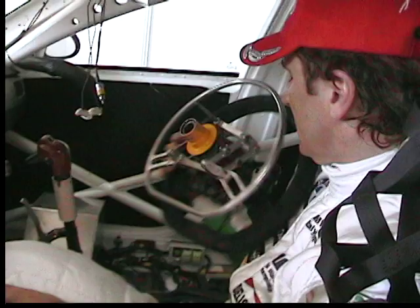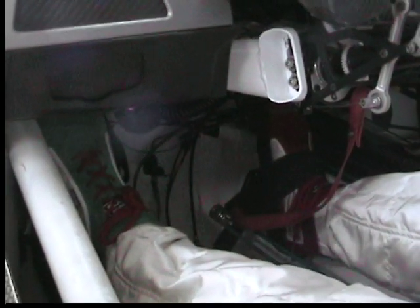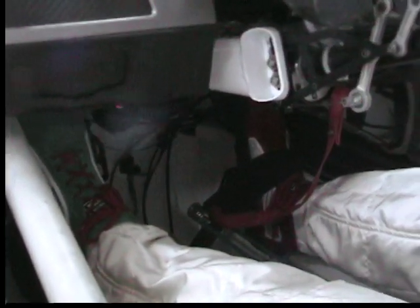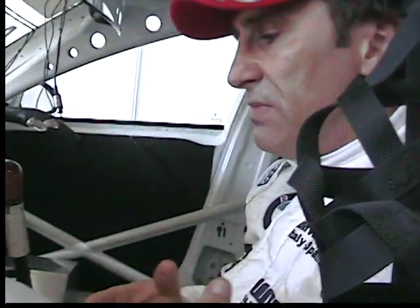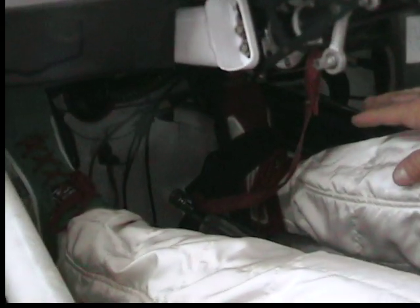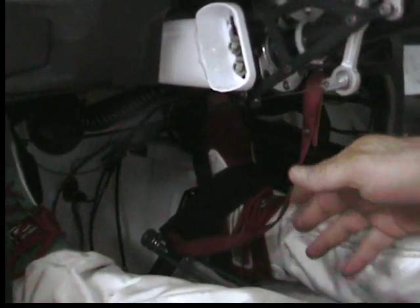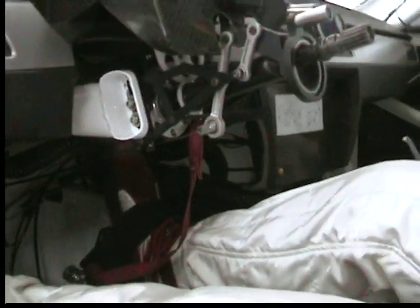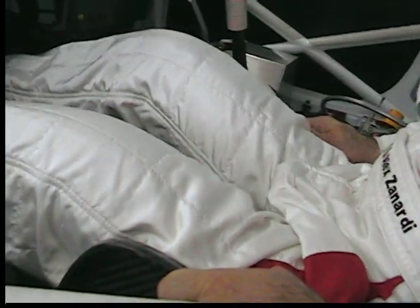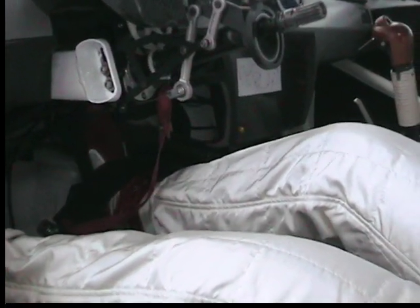Okay. Brake pedal, as I told you yesterday, I use this leg to lean up against the footrest. It's quite important because when I brake, this helps me to keep the weight of my body not to slide forward, and my right foot is consistently trapped on that brake pedal, which operates the same braking system as all the other drivers. And by pressing down with my hip, I push the brake pedal and generate the pressure needed to slow the car down.